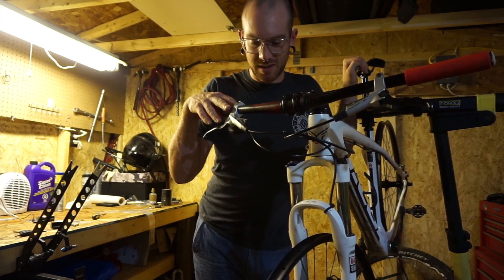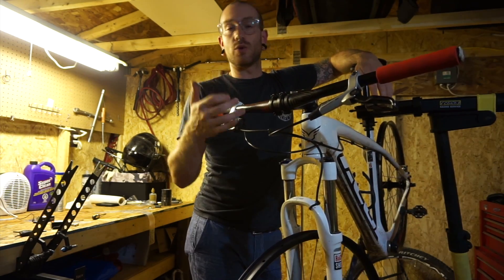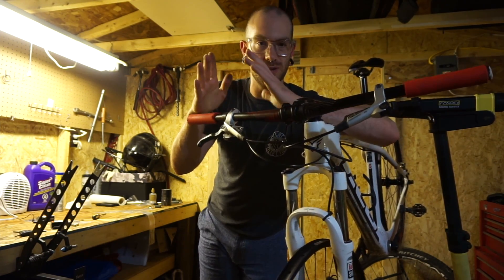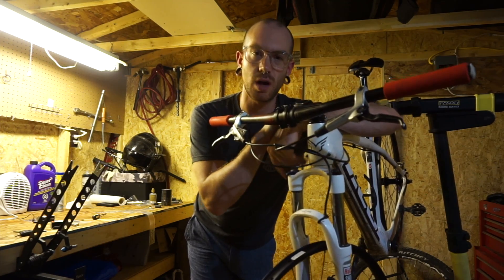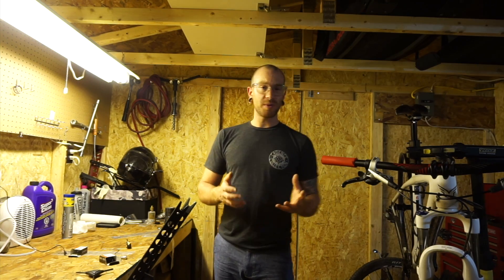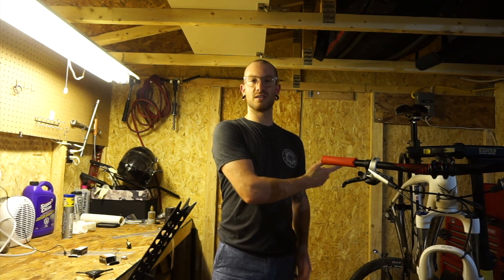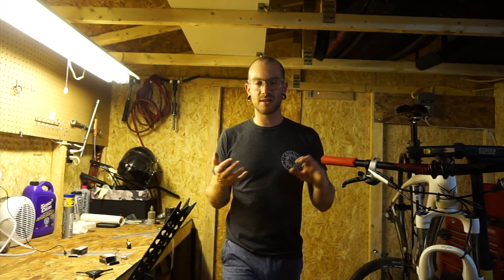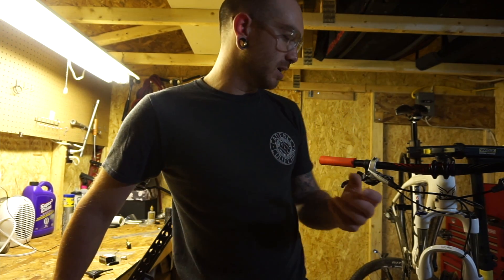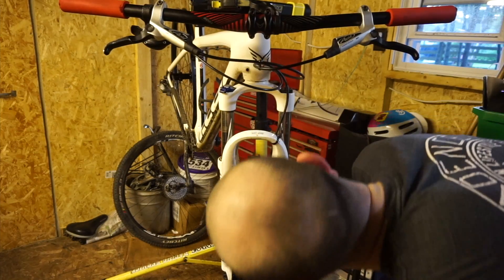Typically speaking, if you were building wheels properly with all the right tools and set up for it at home, you should be dishing your wheels out of the bike — using something to make sure the rim is perfectly centered between the hubs so that when you install it, you know it'll sit perfectly between the fork legs or between the seat stays and chainstay. As you've hopefully noticed, this truing stand is not exactly state of the art, and my stand over here also not really state of the art. I don't have all the tools I've always worked with for building wheels — most notably a dishing tool. So I have to go about it the not-really-recommended way. It might not be super noticeable in video, but the dish of both wheels is off.